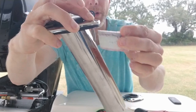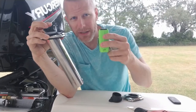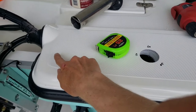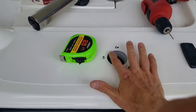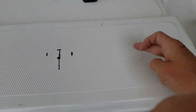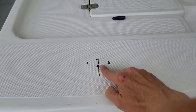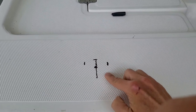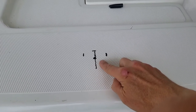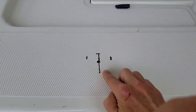Before screwing this in, I've already drilled this hole and I'm going to use it to take measurements so I know where to drill the hole on the other side. I measured from the sides and from the top and bottom to get the position of this hole, then came over to the other side and used a black magic marker to mark the dead center of where the hole needs to be. The best way to do this is to put down masking tape and draw on that, so if you make a mistake you can pull it off without having drawn on your boat.